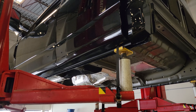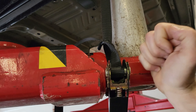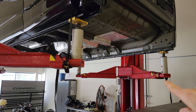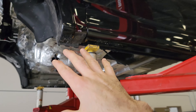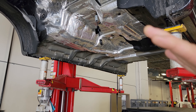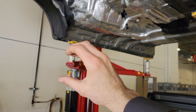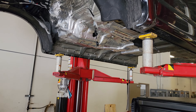Staying with the 18,000-pounders — showing the hoist and the other avenues of lifting a cab. Safety: we are always ratchet-strapping the cabs to the hoist. Doing the crew cab is way better than the single cab because it sits on the hoist better, everything's nice and level. On the single cab, you sometimes have to block a piece of wood or a rubber pad underneath just to get that nice level going up and going down.